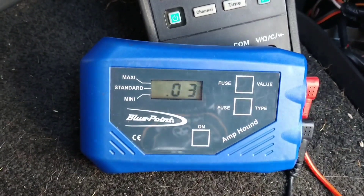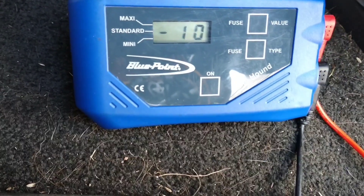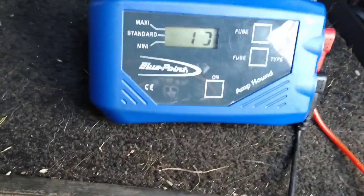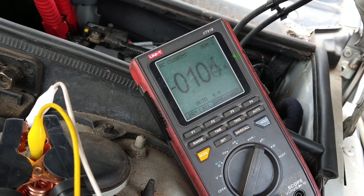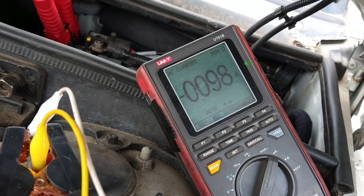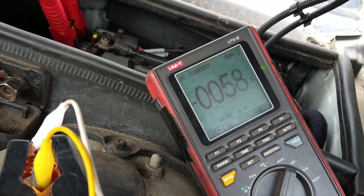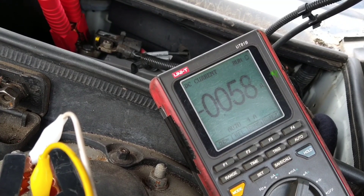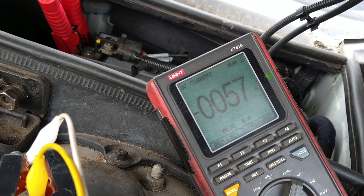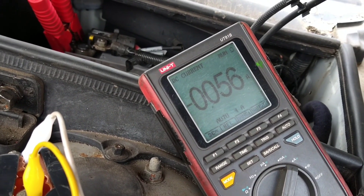So 0.6 millivolts works out to about 30 milliamps. If I take this fuse out, I think we've found a problem. Let's see what's happened at the front of the car to the amperage. It does look like it's that small fuse at the back — now it's down to 50, 60 milliamps. Just a little bit too high, acceptable for some cars, but not this one.